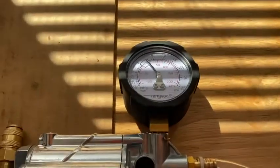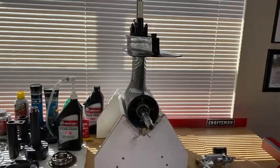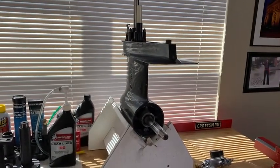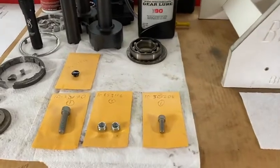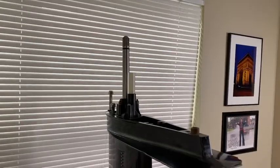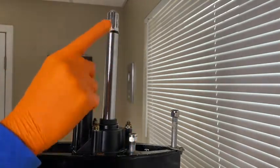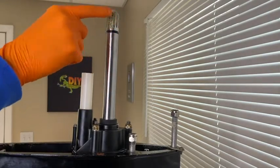This is an incredible hand pump and gauge kit — we definitely recommend it. Scrolling above is a link to a video showing the common causes of an unsuccessful lower unit pressure test, so if air is seeping out, hopefully we can help you pinpoint the exact cause. From here, it's time to install the lower unit to the upper unit. Here's our new hardware with part numbers. We're going to lubricate the driveshaft splines and remove the old hardware. I'm using the Quicksilver 2-4C with Teflon — do not overdo it, just a little grease on the fingertip to lubricate the driveshaft splines.